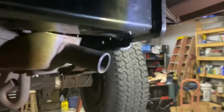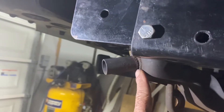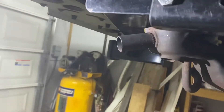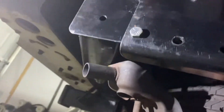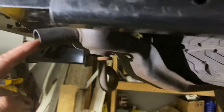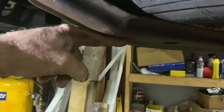The spare tire — this little tab is gonna have to be cut off. That's meant to stick your tire iron in to help you lower the tire to the ground, but as you can see it's gonna make contact when I crank it back up. So I might take some other piece of tube — it's hard to show on camera.